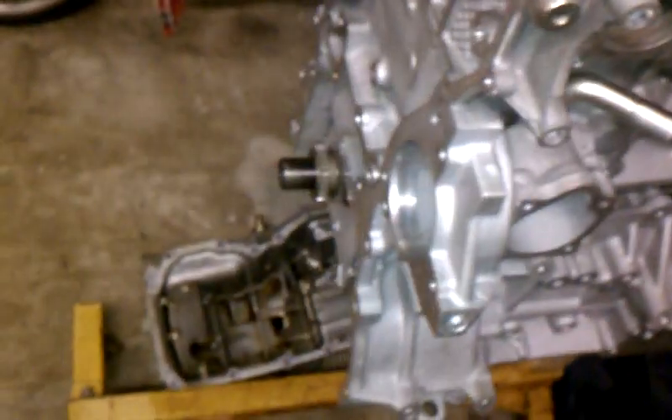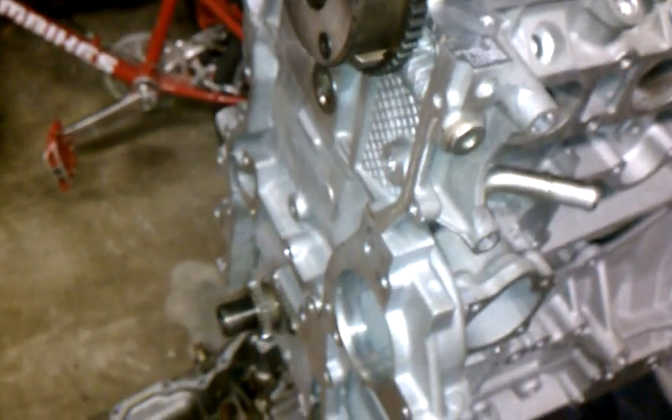Once you get all that in place, then you bolt it together. I don't recommend using the timing tools to hold it, because you have to torque-tighten the front crank bolt to 75 foot-pounds and then go 90 degrees past that. What I'm going to do is take some flat stock and bolt it to the crank - this is my first Mazda, I've done a lot of Hondas. I'll just bolt it in there so I have a two or three foot piece of flat stock with grip tape as a lever to hold while we tighten and get that extra 90 degrees. That's how you set the timing on a Mazda 3 2.3 liter, and most Ford Duratec engines.